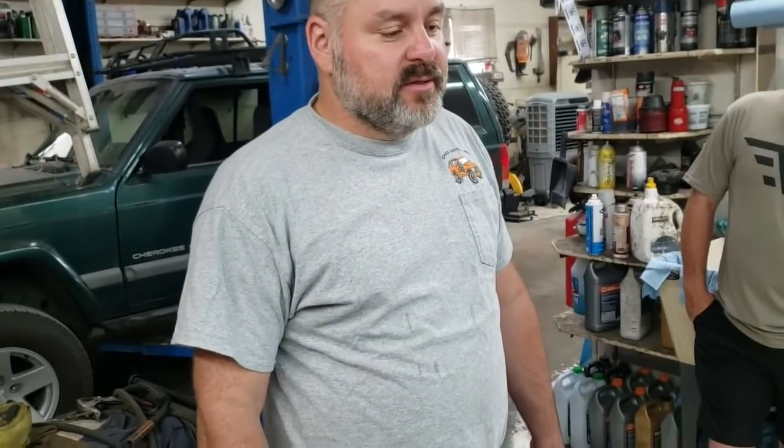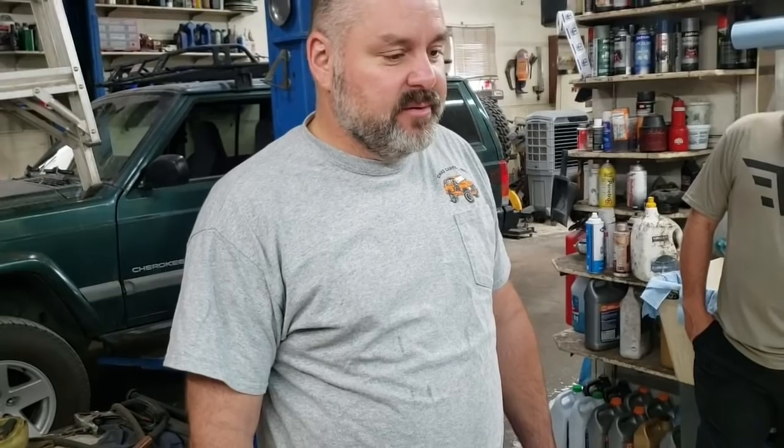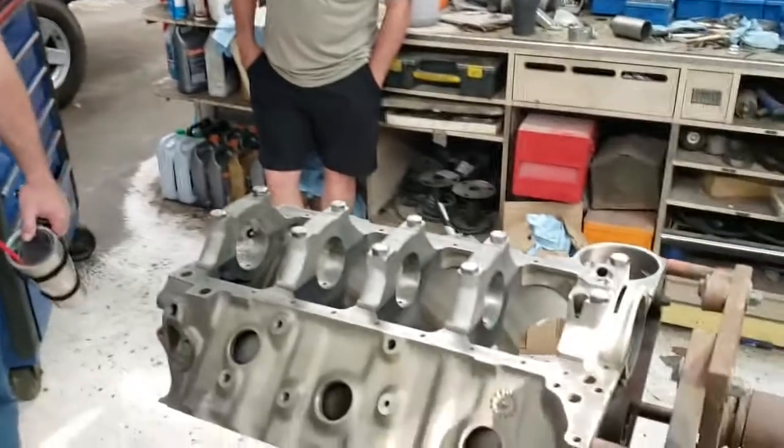With a regular composition head gasket, that'll put us right at about 41 thousandths just in the head clearance, which is minimum. That'll keep our compression high — we're trying to keep it right around 10.5 to 1. We didn't have to grind on anything, so that's a big win. Made it like a one-hour project — well, really a twenty-minute project and forty minutes of BS time.